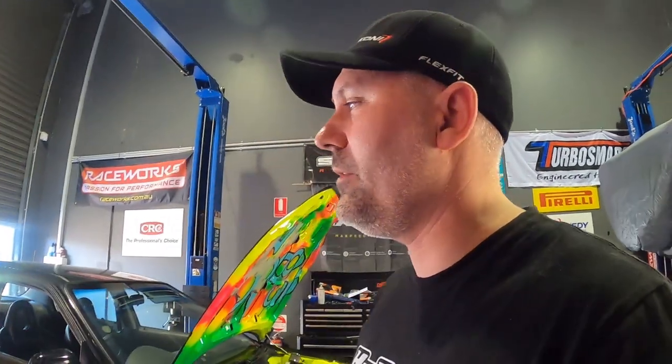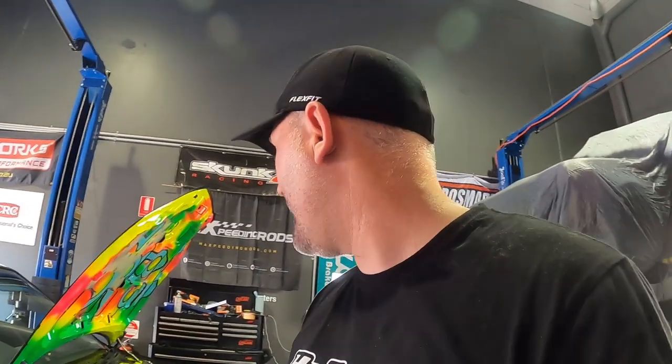Down the line — not right away because of money — we'll get that done and get the car tuned. At the moment it's running and driving just fine. I might also put bigger injectors in and a bigger fuel pump. Evan from Unigroup said we're pretty much at 80 or 90 percent of the fuel injector capacity, which is not where we want to be, especially at only eight or so PSI. I want to run it to about 10 PSI, and I've got dash six fuel lines all under the car, which should be plenty.